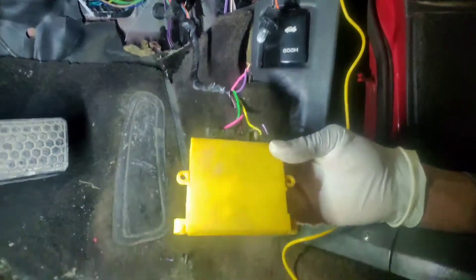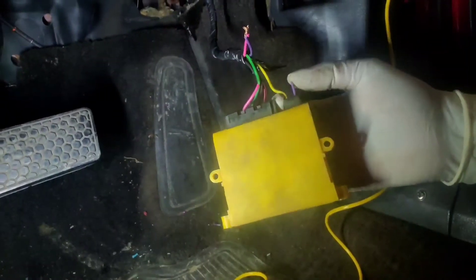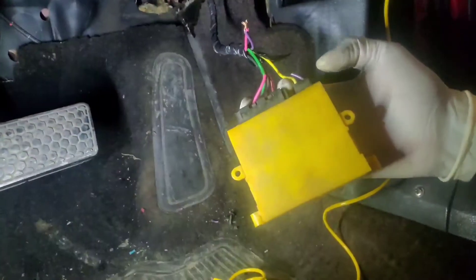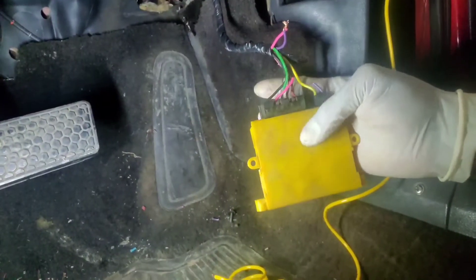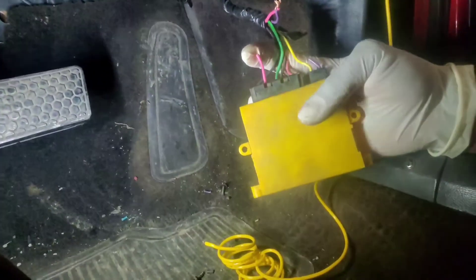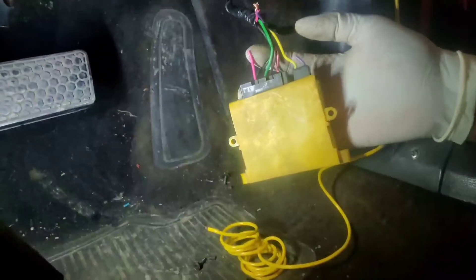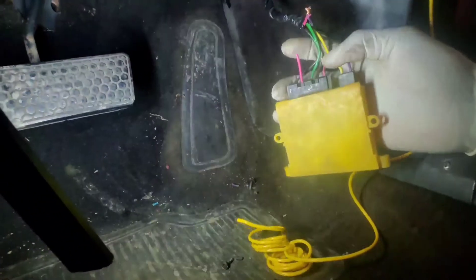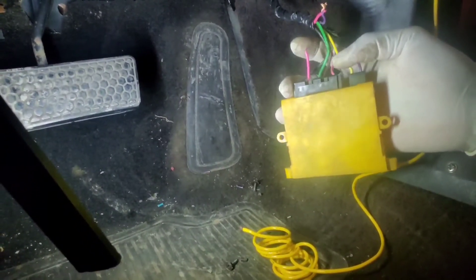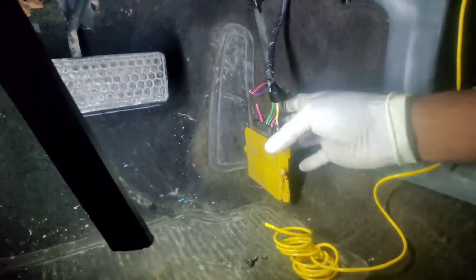On the speed buffer box, you've got two wires going in from outside under the hood — your yellow and your purple wire. That's the vehicle speed sensor wire going into the buffer box. That signal gets changed by this buffer box into some type of pulses, which get sent via this bright pink wire to the dashboard. So basically what you want to do is get your signal from that PCM to this bright pink wire.